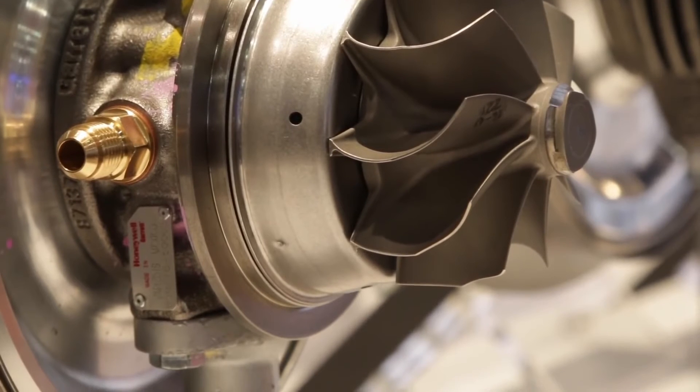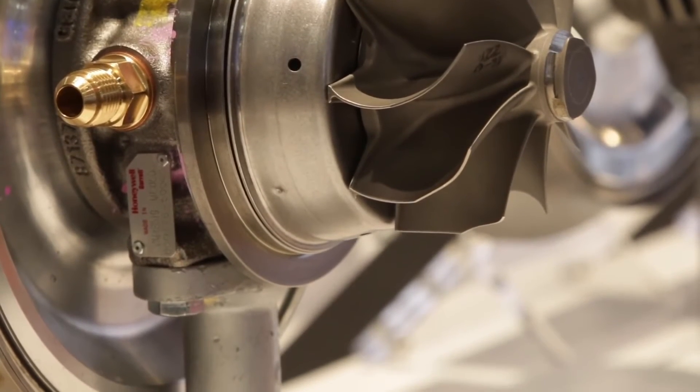The water ports on the sides of the turbocharger are for water cooling. We provide the fittings on the turbocharger as well, and that's for the durability of the turbocharger — you want to keep it as cool as possible.